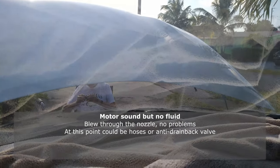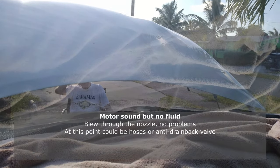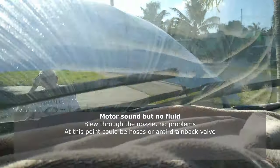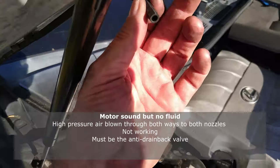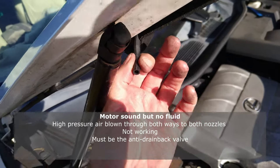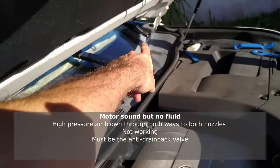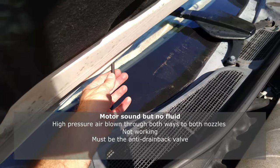What we're going to find out is that the driver's side is much more pressurized and the passenger side is hardly coming out at all, so something else is going on. We've tried high pressure from a compressor on this hose — it only comes out the driver's side. We've tried high pressure on the other hose and it doesn't come out anywhere.